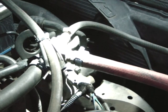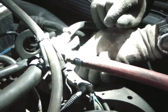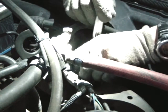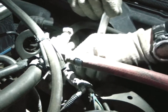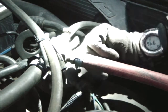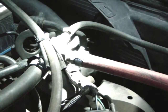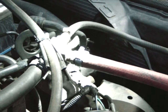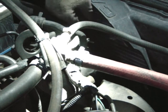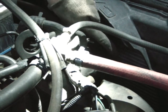That gentleman also said in the video that this was a 10-millimeter — and it seems as though it is, for these three bolts. Let me make sure I've got sufficient fluid drained off. So further going through the troubleshooting: we tried all the cheapest and easiest. We considered the fan — there's a little bit of resistance. I think the fan is supposed to spin as many as five times freely, and this won't spin at all.